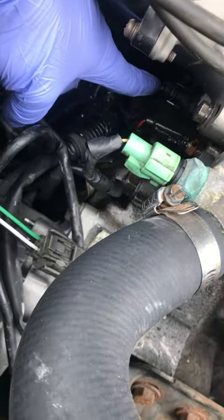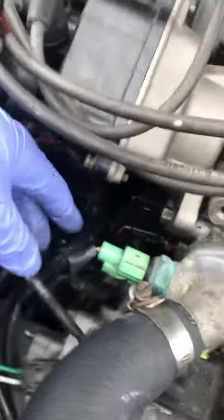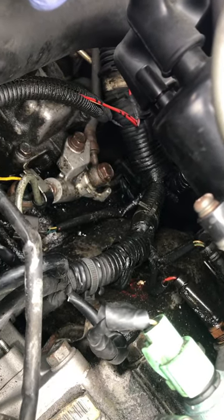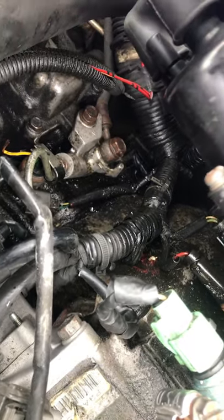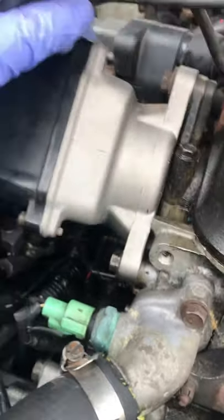This will affect a lot of things — we have all these sensors down here, I think that's a coolant temp sensor. The oil will drip down and make a mess on your connectors, and if it's been happening long enough it'll actually start to eat away at the casing, causing electrical issues. The secondary damage of this is actually your VSS — so if your speedometer does not work, more than likely you're getting oil on it or you have a short somewhere.